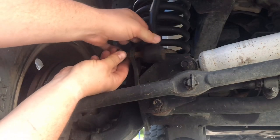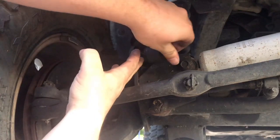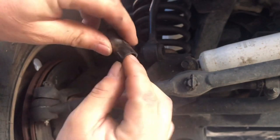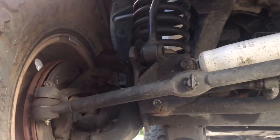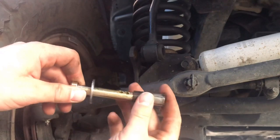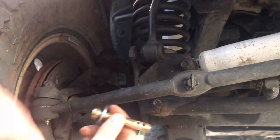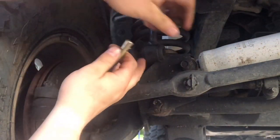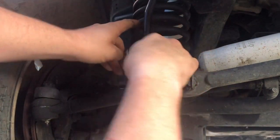It's much easier to get this bolt in and out if you have the vehicle on level ground. There's a metal bushing — it has a line down the middle, you can see that. You might want to take some sandpaper, clean this up real good with some WD-40, and open it up just enough so that your pin slips easily in and out. That way when you go to disconnect it on the trail it's trouble-free, no issues. You should always bring some tools just in case it binds up or you're not on level ground.